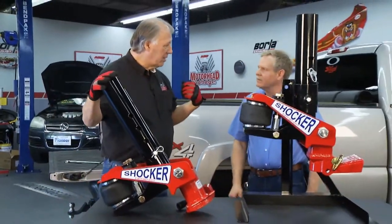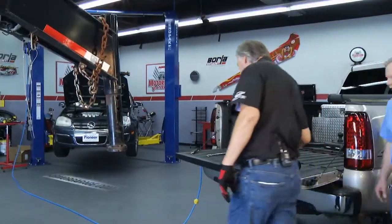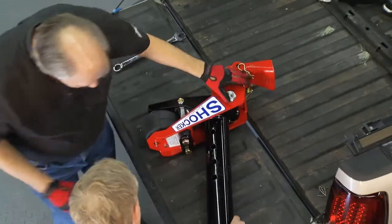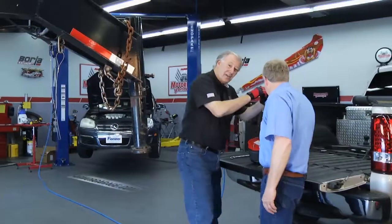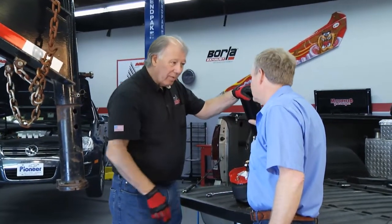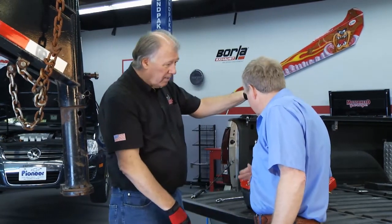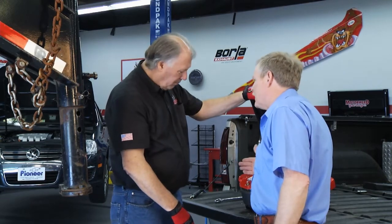Let's get this old hitch off. Let's get the new one on. Well, let's get her going. Okay, Bob. Now, this is one that we've already got set up here, folks. Now, Bob, a couple things you want to do before you start to install this. And one is you want to set the air on this, don't you? Right. Normally, we preset the air around 20 pounds and then adjust it up or down, depending on your trailer weight and how it tows.